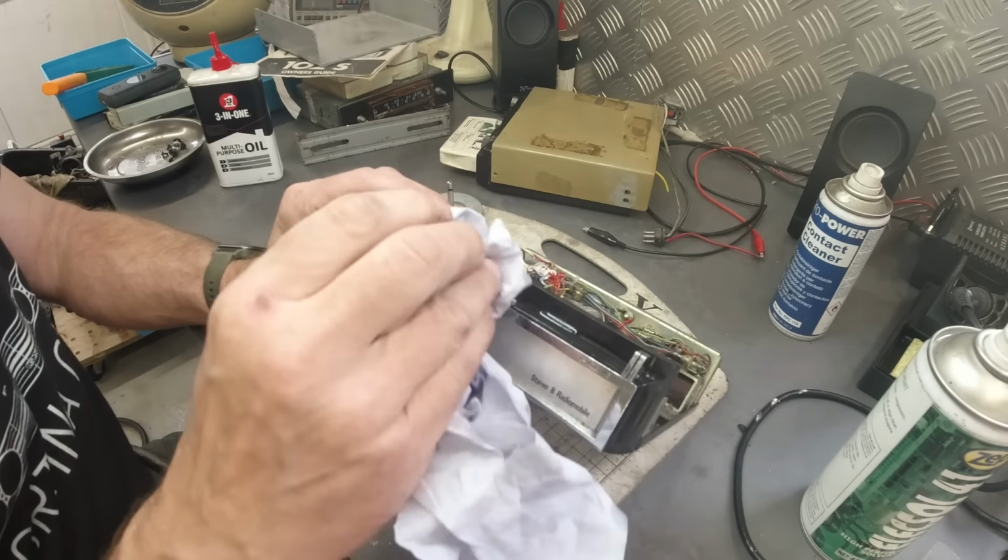I've noticed this has broke loose. There's some diodes there. The reverse polarity stopped you wiring it up the wrong way to the battery. That's broke away and it looks like it's soldered on with a little bit of solder there. So that solder's broke. So we need the hot iron, the high temperature soldering iron to get that, because there's quite a bit of metal there. Bench iron won't do it probably.